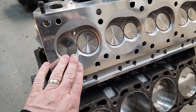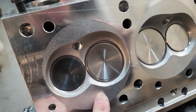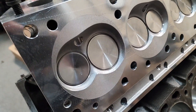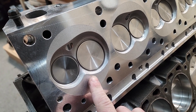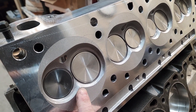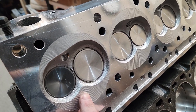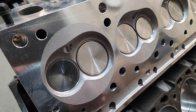One of the things we had them do was soften the chamber. If you look, you can see these little grooves going around — it looks like a record. What that is, is the quench area — basically the flat part of the combustion chamber. When the flat part of the piston would come up to this quench pad, that's the area where detonation can occur. What some boosted guys will do is soften the chamber and take these quench pads and put a slight angle on them towards the valves, basically eliminating the quench without dropping the compression too much. That's why the head was actually shaved — we were going to soften the chamber and actually angle and taper this quench pad. Let me get a straight edge here and I'll show you.